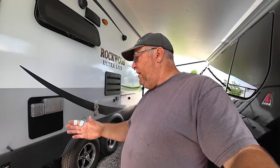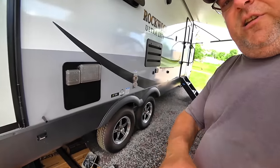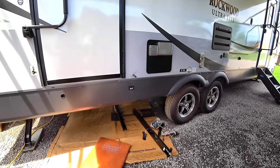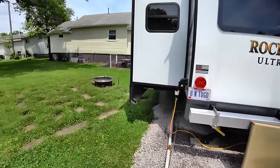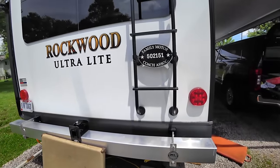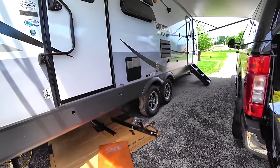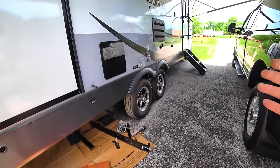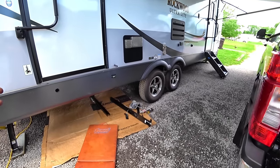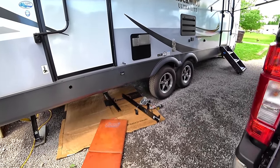You have one other decision: depending on what your trailer has, which side of the RV you're going to have the screw mounted on — the part that actually lowers and raises the spare tire. If I have a blowout, you're going to pull off the side of the road and traffic is going to be winging past you. The last thing you want is to give yourself an excuse to spend more time on that side of the road. So I'm putting the screw on the passenger side, because if I pull off, the passenger side will be in the grass or the berm far away from traffic. Even though the blowout may happen on the other side, I won't have to crouch in traffic to lower my spare. I suggest you do the same.